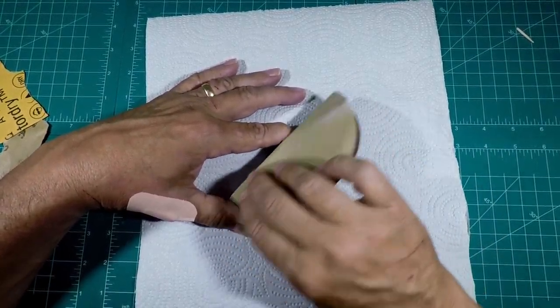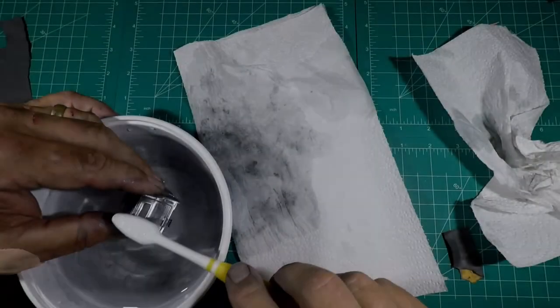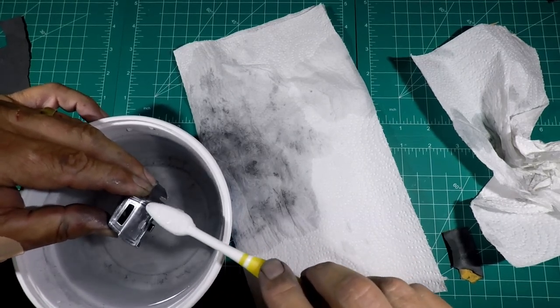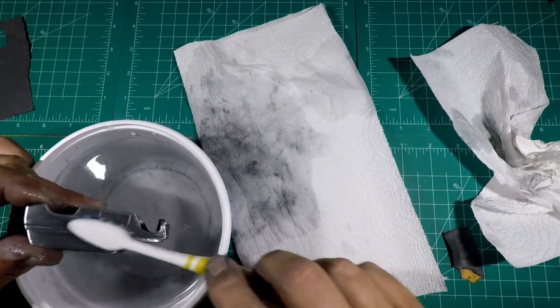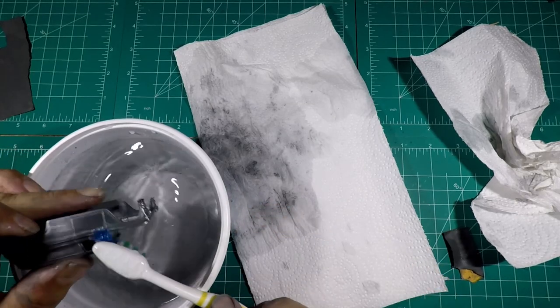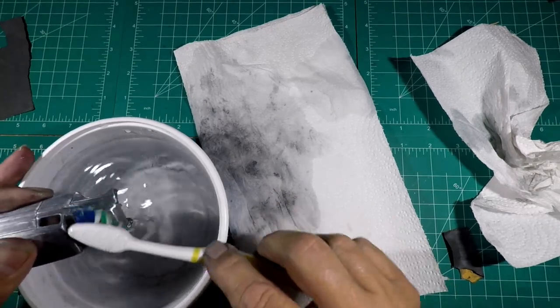Plus, we don't need it because this one's going to be primed and painted. It's not going to be a polished job. So once we get it sanded and everything, we want to take a soft bristle toothbrush or whatever kind of brush you got, paintbrush, whatever, and just run it over the body to knock any dirt, any filing material, any sanding material out of the crack